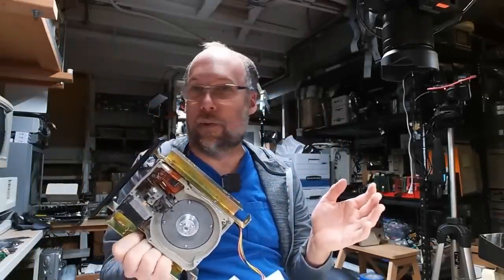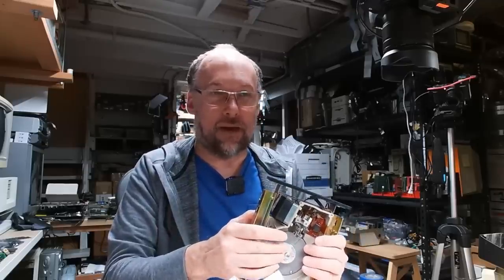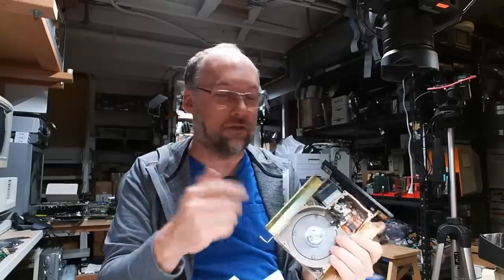So obviously this hard drive spun once before, that's what the note said, but it said it didn't respond, which meant the computer was giving hard drive error messages like the other ones were doing. But now I had that stiction problem, and when I broke it, it scratched the disc, and that was that. So this hard drive was never gonna work again.